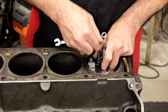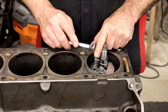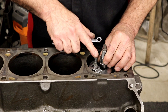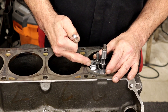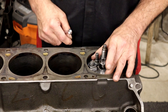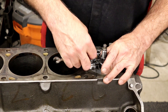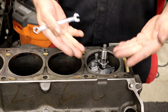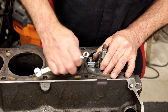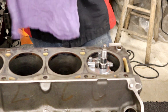You'll have to adapt either higher or lower depending on your particular engine and how high the ridge goes. Flush it — tighten it. This one here is what moves it in or out; that moves the blade. I put the blade all the way in, loosen this up, slide it out till it touches, then back it off just a little bit. Tighten it — set it and forget it. It's spring-loaded, so now there's tension on the blade.